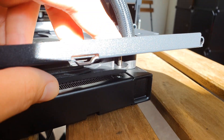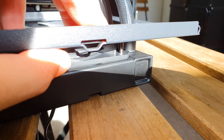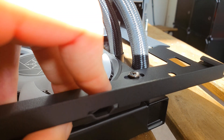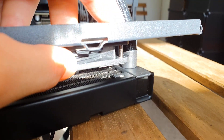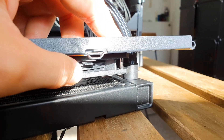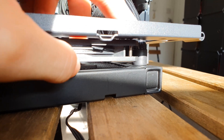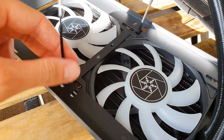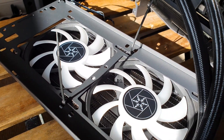The main problem comes from the stock installation screws for the fans. Due to its slim nature, it's understandable that Silverstone made sure the top of the bolts will not protrude above the fan's frame footprint. But the downside is they have no extra room to accommodate a tray case installation like my testing case, since in a normal enclosure you attach the radiator to the case rather than using the fan bolts. I used zip ties for a temporary quick fix — not the prettiest, but it did the trick to complete testing the AIO.